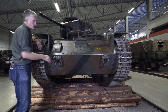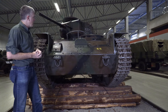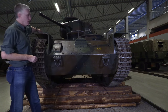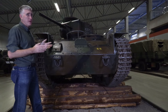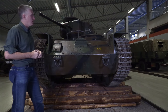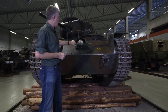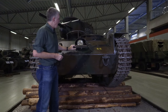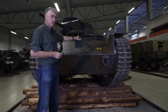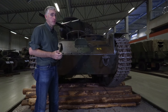Features on the front include towing or lifting mounts, ventilation for the powertrain, and the main service headlight in the middle. On the sides there are low intensity lights — more to show where the tank is than to illuminate ahead. There's even a small reflector underneath. The main headlight is behind an armored shroud with shutters that filter light downwards, reducing visibility of the vehicle from above or from the air.